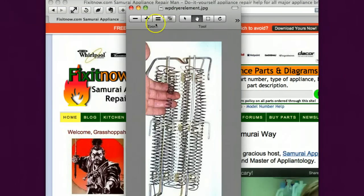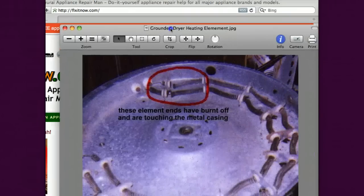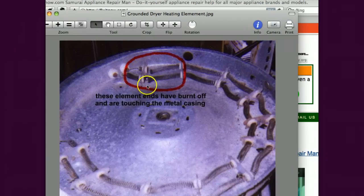And I'm going to show you one more type here. Here's another type similar to what we looked at at the outset — if they burn off and touch the metal casing. The other thing that can happen on any of these electric elements is you can get a piece of metal. It could be a bobby pin, bra wire — you find all kinds of things that get caught down in here. And it can bridge from the heating element to the chassis and make that electrical connection, and make the heating element always have voltage going to it.